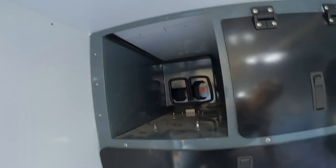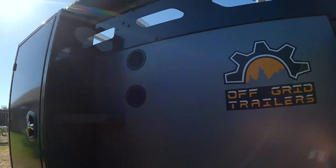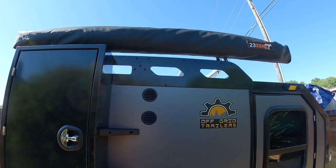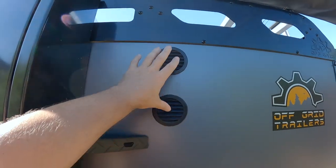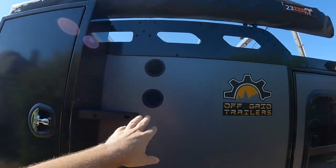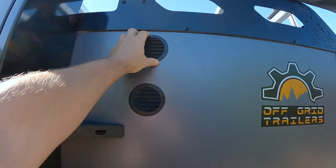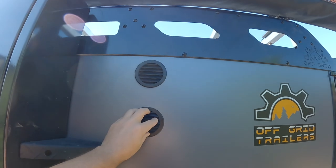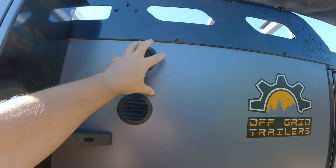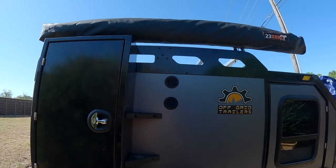I submitted another warranty claim and they told me they recognize this is a design flaw. They are shipping new units with permanent screw-on caps — so you'd screw them on when traveling and unscrew them as needed. I'm on the list to get those, and once I do I'll show everybody what they look like. If you're ordering a trailer with AC prep, you may or may not get it with this issue — if you do, submit the warranty claim. In the meantime, one workaround is to take these off, put an RV AC filter behind them, and glue them back on. Others have used painter's tape over the vents while traveling as a field hack.